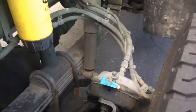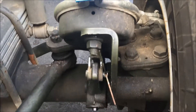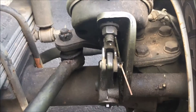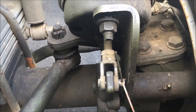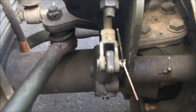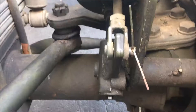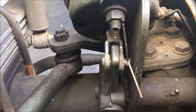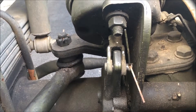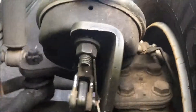Now we're going to come out to the outside of the vehicle, and I'll demonstrate how the brake chambers work when the brake is pressed. As the brake is pressed, the diaphragm is filled with air and it moves this plunger outward, which engages the brake. As we release, it retracts and pulls back in, and the spring pushes the plunger back in with the diaphragm.